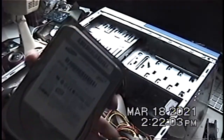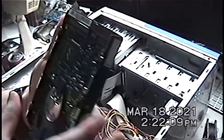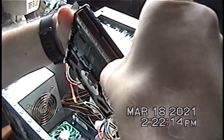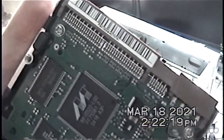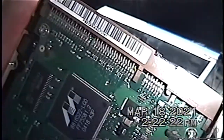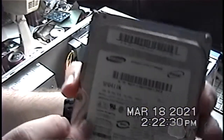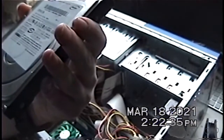I'm pretty sure it came out of something else — probably the D530CMT that I had for a while. But this is jumpered for what looks like cable select, and I don't want it jumpered for cable select, so I'm going to fix that. It does actually specify — it says Master, Slave, Cable Select. The jumper position suggests that Master is the one closest to the interface, so I'm going to go ahead and put that one in now as well.